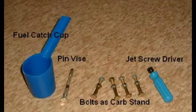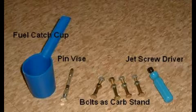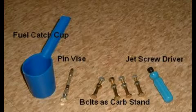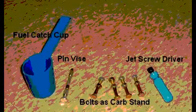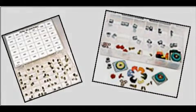Only a few simple tools are needed to help with power valve and jet changes. Four 5/16-inch 2-inch long bolts with nuts make a low-cost carb stand. A pin vise and small drill bits can be used to increase squirter size, but do not drill out the main jets — the inlet shape is critical in defining flow. Holley sells parts kits which are very useful. The price of the jet kit will pay for itself very quickly versus buying separate sets of jets, and it also allows changes in small increments.